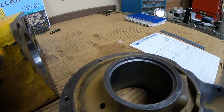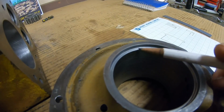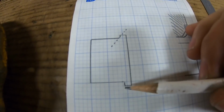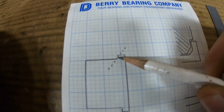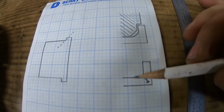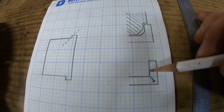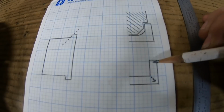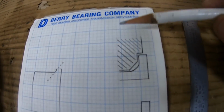And looking very closely at the contour of the step right here, you can see around the inside, I had to put a 45 degree bevel edge on there that's about a 1/32 wide, because with this accompanying sketch, we could not leave it as a square stepped corner like that. You can see this dotted line. I did cut just a 45 degree chamfer on that just to take the point off of that transition, because when I make the new bearing, if I flanged it out and left the inside of that transition at 90 degrees, stresses always center on inside corners right down at the point, and that's where cracking would start. Any kind of forces that are applied to that flange are all gonna zero right there, and you start having problems.